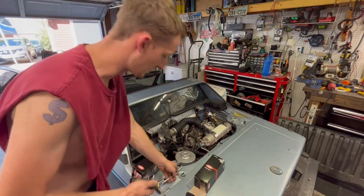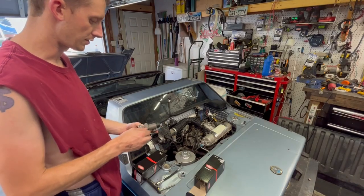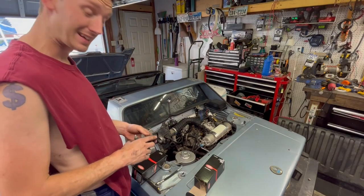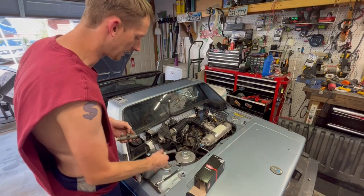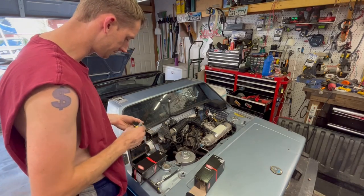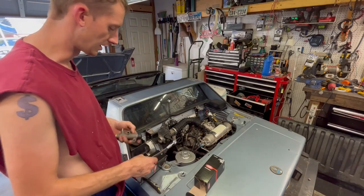All right. So what I'm going to be doing, it's going to get tough to get you guys down in there, but it sits in there like this. We've got one bolt on the top, one on the bottom. We're gonna need to get that out. So what I would like to do is keep that same rod in there or take it out and try and match it. That way it sits in here the same way. And then we'll reattach our line with our clip.